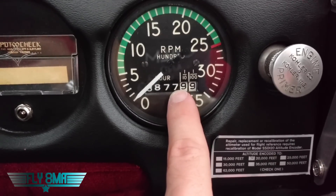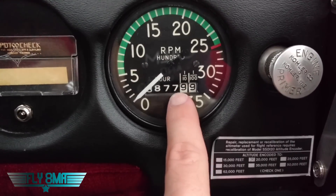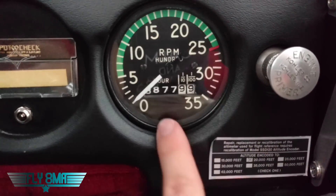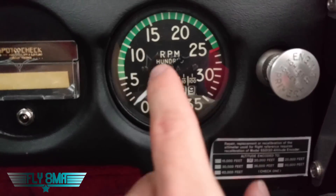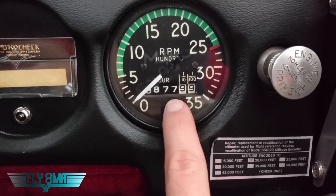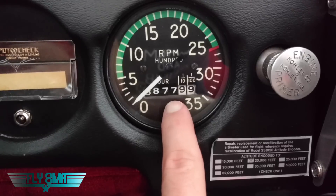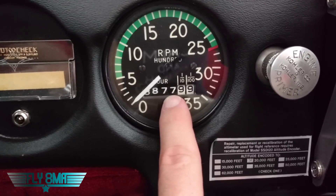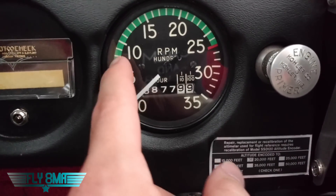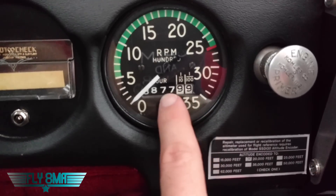It's important to note that if you fly the airplane at 2,500 RPM for one hour, this will indicate that you flew for one hour. But if you have the airplane run at half that — at 1,250 RPM for an hour — it's going to indicate half of an hour. So it's actually indicating time as a percentage of RPM, with the theory being that higher RPMs mean more wear and tear on the engine. Your maintenance is based off tach time — your 100-hour and things like that. So your total time on the engine, when you see 4,000 hours on an engine, that's probably 4,500 or 5,000 hours on the clock, because for some of that time it was running less than the designated cruise setting.